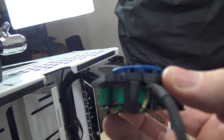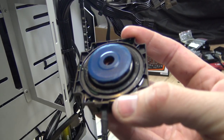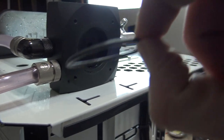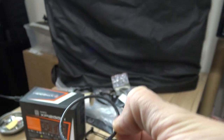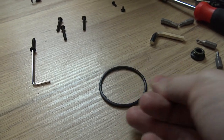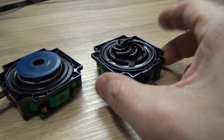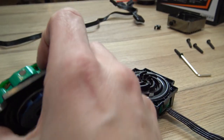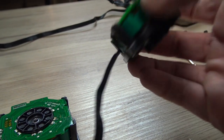O-ring appears all right. It's a little bit different blades on this one than that one though. Huh, that's actually quite different. The O-ring looks fine. So, all right, at that point, we definitely can't call this fluid related. Interesting that there are two different impeller designs though. I mean, everything else about these pumps are the same. If you take a look at them here.